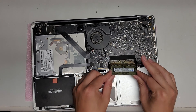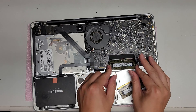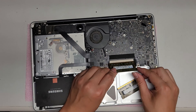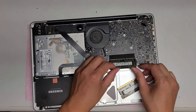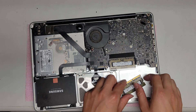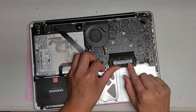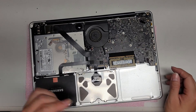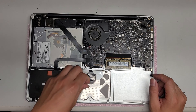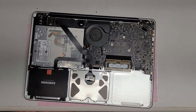I also like to check that the RAM didn't get messed up from all that flexing. Take the sticks out and put them back in — clean off the connectors. Gold doesn't have any issues with corrosion, so it's not really a problem. Make sure you have yourself grounded. Put the RAM in at an angle, push it all the way in, then push it down to lock it in place. That's pretty much all there is to it — get a new battery and replace it. If you want, you can replace the trackpad too if yours is really bad; I think they're about $25.